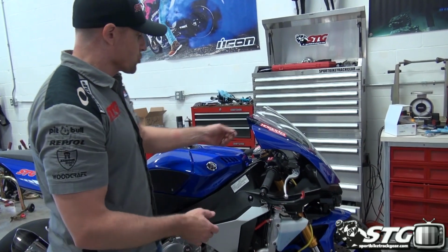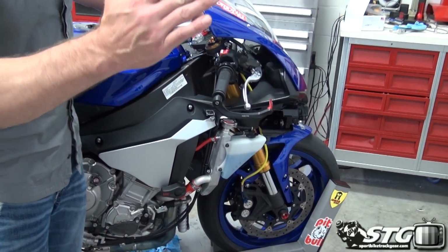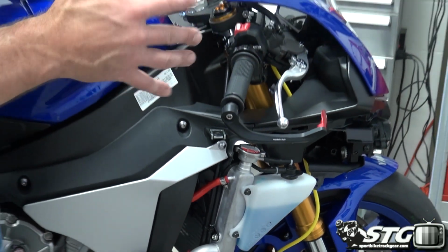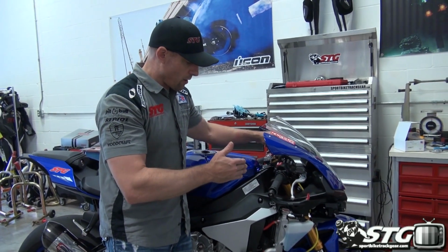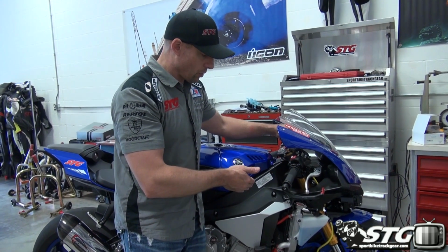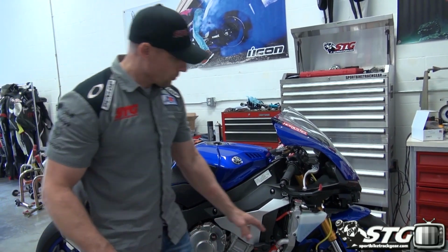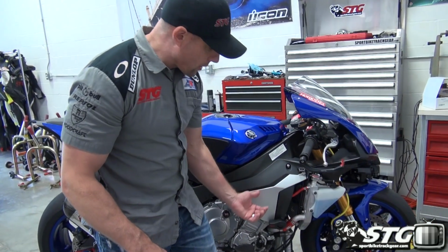So basically, start your bike, run it. You're going to see it go over, a little over 230. It's going to start to cool down. Your fans are going to be on at 220, right? Let it run until that temperature stabilizes at idle, somewhere in that very low 200s, okay? Shut it off, let it cool down. We've got pressure built in there. Inspect for leaks, okay? And then if we don't see any movement yet in the coolant reservoir, remember, after your first ride, you're going to want to take a look at this because you may lose a little bit from here and draw it into the radiator.